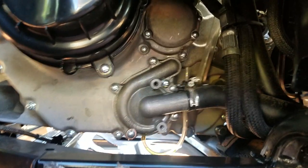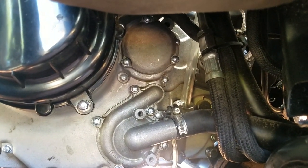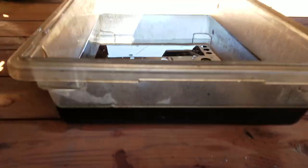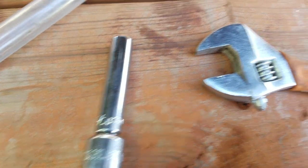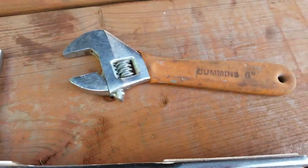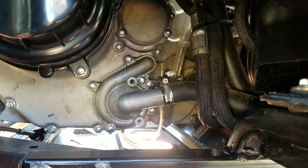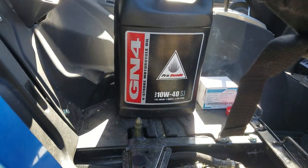Above your water pump are three little bolts that you take out, and that plate comes off — and it makes one hell of a mess. It is five-sixteenths, so you need a five-sixteenths and a crescent wrench and a pan, and be ready for a mess.